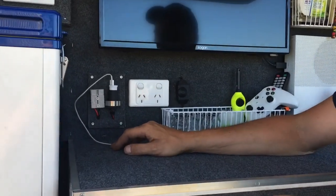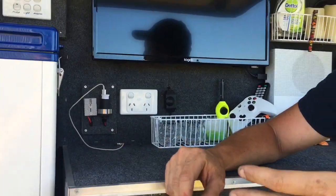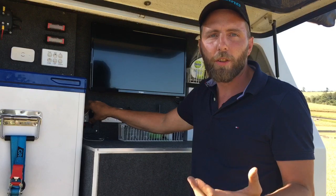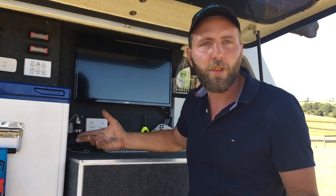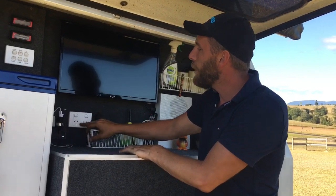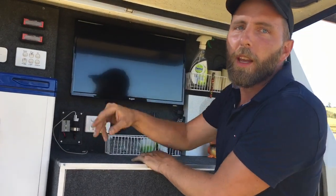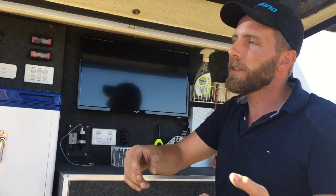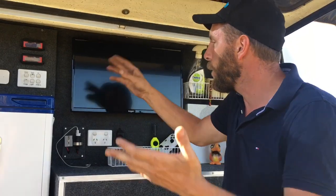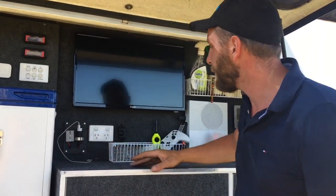And we also have an AC to DC charger if you want to park the car in a garage and have no sun, and you don't drive it. You can just plug in the 20 amp charger we have, and it charges your battery. That's the TV. That's the 220 volt outlet which works with the inverter. And when you're at a power station or in a camping site and you have 220 volt from outside, just plug it in up there and it will run everything with 220 volt.